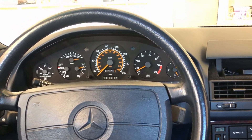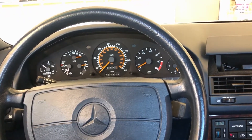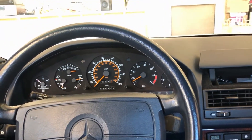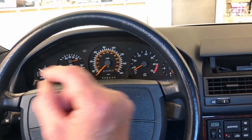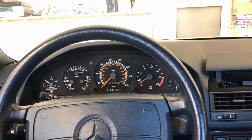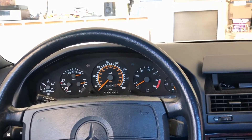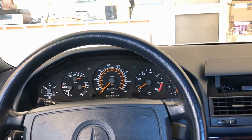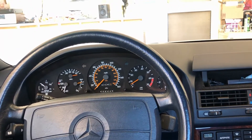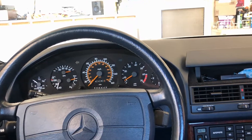The air filters were from a previous owner. They looked clean but they were old. You could not see light through them if you held them up to the sun or a bright light. I ran the numbers on the side of the air cleaners and it's not a Mercedes number — it turned out to be a Chinese manufacturer. When I put it in Google, they were caca parts. I have never in my life, with probably 30-40 cars I've owned, had an issue with the air cleaner causing cold start problems — live and learn.